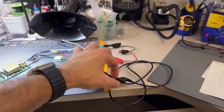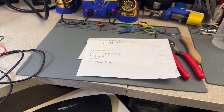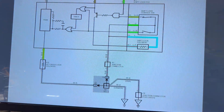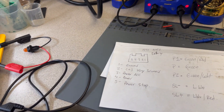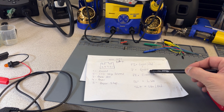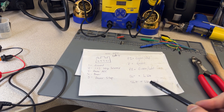What I'm doing here — this is the gear selector switch connector. All I'm doing is having the common wire on the center, which is a green wire, and then we're going to have green with red. Let me put the pins in here so you can all have that. It's very easy to decipher what is in there, and then we can all use it for testing — that's what I'm trying to share with you. We have the shift selector switch and the shift lock solenoid. The negative part will be light blue and the positive side will be light blue with red.